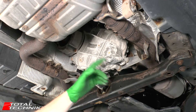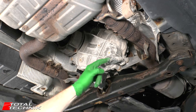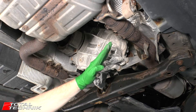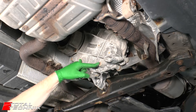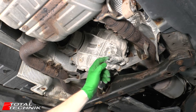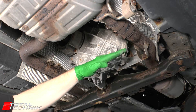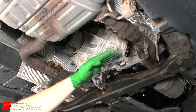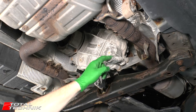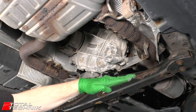Now lifting the vehicle itself isn't the problem - the problem is that we need to lift that vehicle evenly, because these plugs are wholly reliant on gravity. If you just jack up the front of the car then obviously that's going to throw gravity completely off and that will throw these fill levels off. So if you are going to lift the vehicle you need to lift all four corners evenly, and obviously without a lift or a ramp that's quite a difficult thing to do. You'll likely have to use axle stands so you can get a nice even lift on each of the corners. Unfortunately it is a complete pain if you don't have a ramp, and often just lifting the car is a lot more complex than actually changing the fluid itself. But whatever you decide to do, just remember that the car must be lifted evenly.